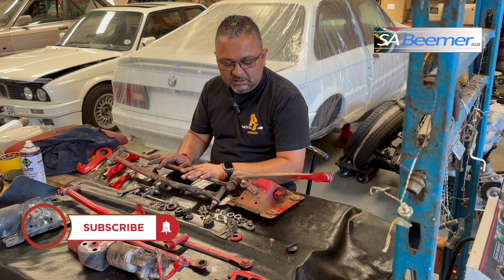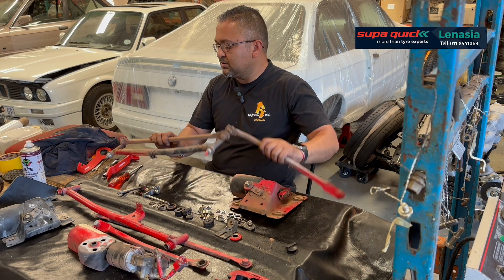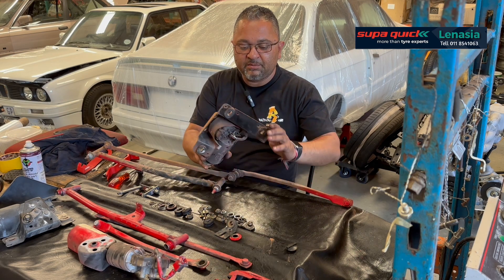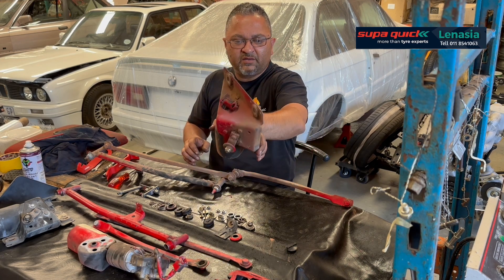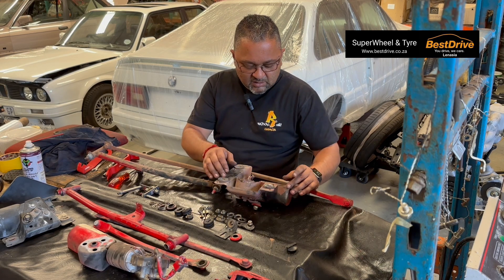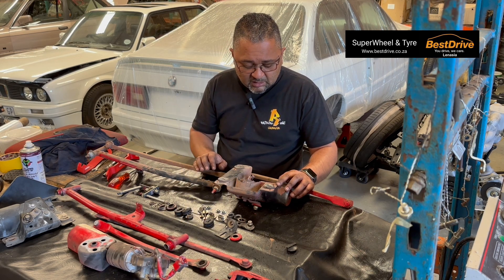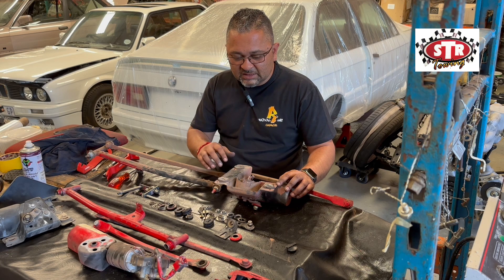The wiper motor mechanisms - this is what they currently look like on these vehicles. They're split up like this normally, but there's a lot of overspray everywhere. This one is still okay, it's still got its grommets in place, but the grommets are probably going to be tired and brittle. This one here has broken clips on the plug, plus a whole lot of overspray and dirt.